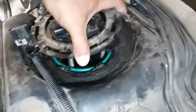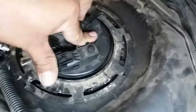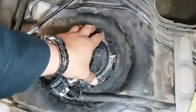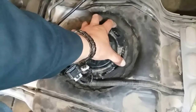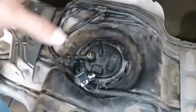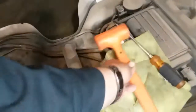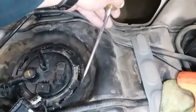So this flap right there is going to go down in here, just like so, and then we're going to secure this. You might need both hands to do this. Push down a little bit — not all the way down. This is as far as you can go. I'm sure there's a special tool for this — to grab on to all these little openings and to tie everything down. But we don't have that. We have a dead blow and a flathead. So we're going to stick the flathead in here and ever so slightly tap it until it locks and secures.